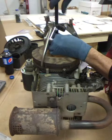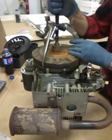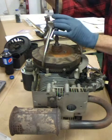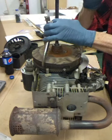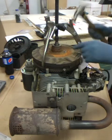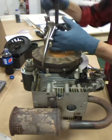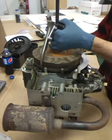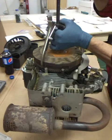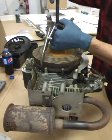Sometimes these are a handful for one person. Tighten that up. There's a trick to get these off - you don't want to just tighten it up as tight as you can. Put some pressure on it, then tap on it with a hammer. The shock will go into the taper and it should pop it apart. If it doesn't, just tighten it up a little more and keep at it until it pops off. Sometimes they rust on pretty good.